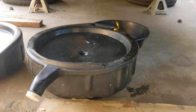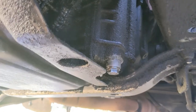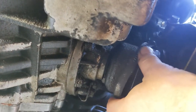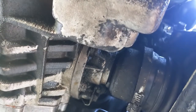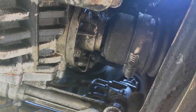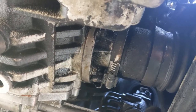Underneath the car, I've moved the oil drain out of the way and put the drain plug back in. On each side you'll have the inner driver off the transmission — this is the inner boot for the CV. Saab uses just a hose clamp here. If your CV's been replaced by a random shop, you may actually have an earless crimp clamp that you have to cut off. Hopefully you still have the original Saab hose clamp. Go ahead and take both off, one on each side, and let them sit there.